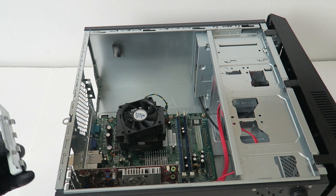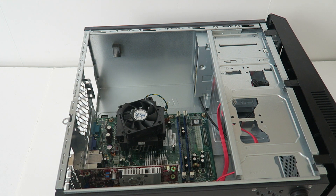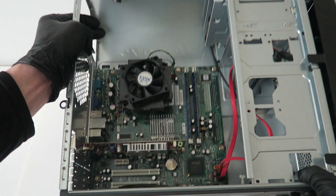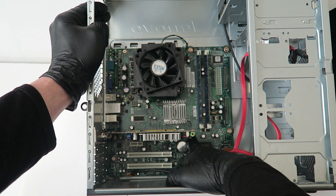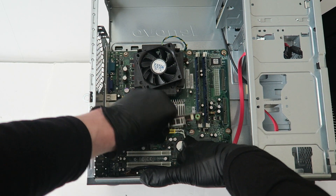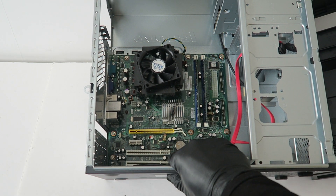This is where the PCIe brackets are. You see the little clip where it holds up — you have to remove it; it's held by one screw. Remove the GPU card. There's a little clip on it, you press it down with your finger, and the GPU card you're able to remove like this. That's what you have to press down before you remove it.